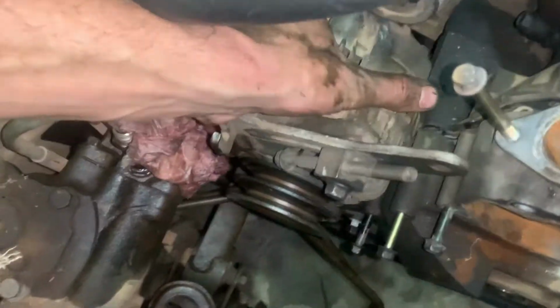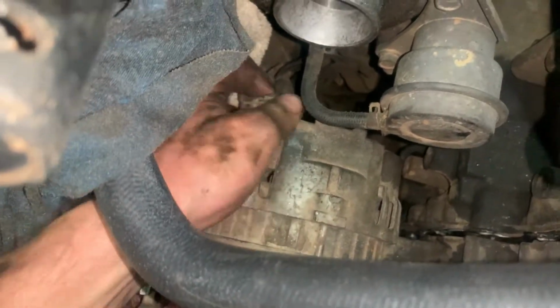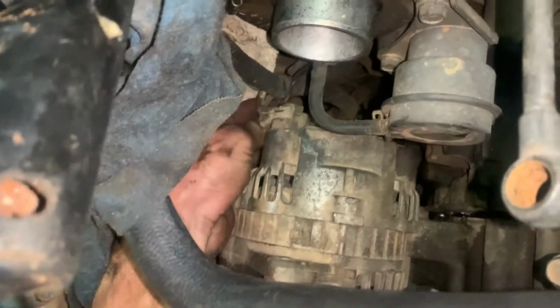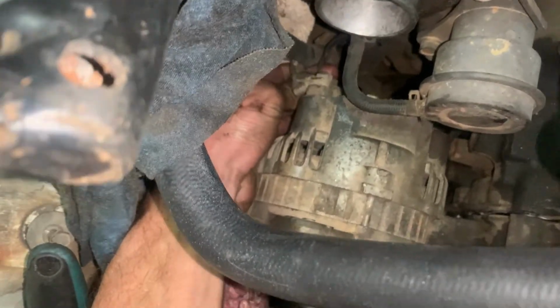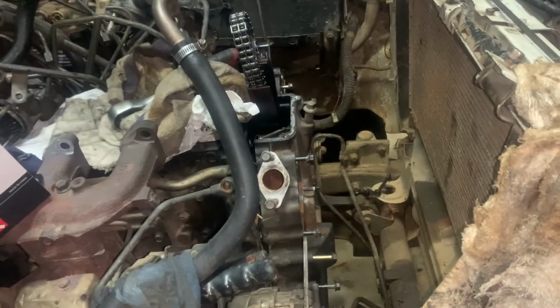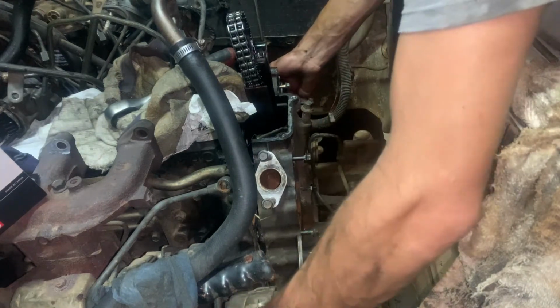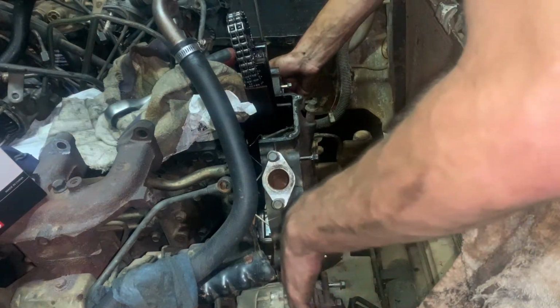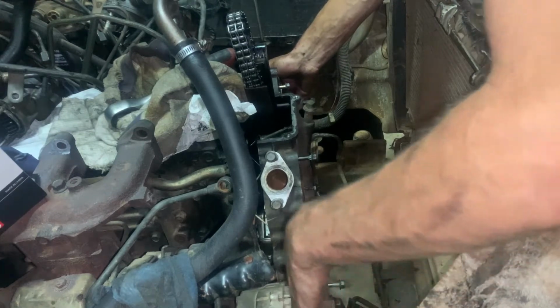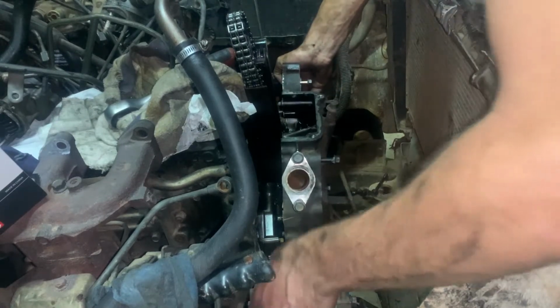So let me quickly disconnect the alternator. I'm just going to take off these 2 bolts over here. We'll unplug this guy, actually. Don't even need to disconnect, unbolt them. Just unplug, oh, there goes the tool. Unplug this connector over here at the bottom, and then take off that top bolt, and then we can take the whole timing cover off with the alternator. So let's quickly do that. Let's see what happens, guys. I think we are ready to rock and roll. Let's see. Please. Oh, yes, boys. Get in. Right.